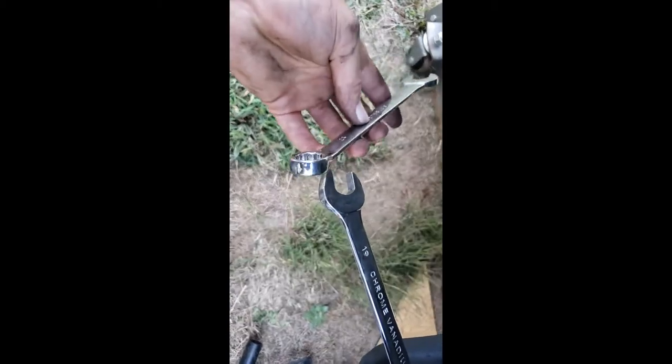When you're taking the knuckle off, it'd be better to do the bottom one first - loosen that first - and then do the top ones. I had to put the nuts back in on top, then stuck a hammer against the back side of the knuckle, and then did the old double wrench trick. I looped it through like that, and that's how I got it off - I was able to break it loose.